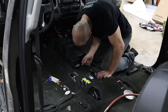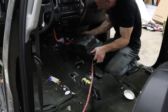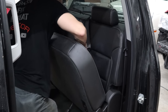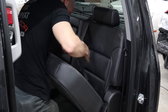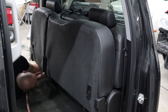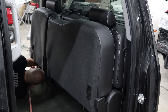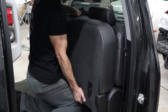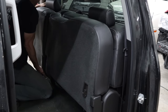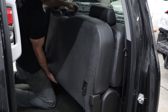Now we're going to pull the sub out, then on to the rear seat. Just disconnect the seat belt first and fish it through there. There are about eight bolts across the bottom; once you take all those out you can lift the seats straight up - they latch in the back. It's actually two separate seats; you can take them apart if you want. I'm going to take them out and then take them apart, just so they're easier to handle. It's just two bolts that hold them together.